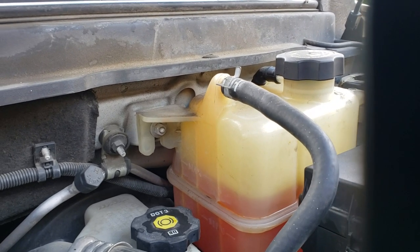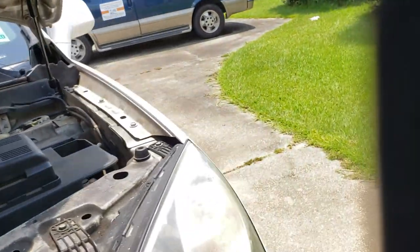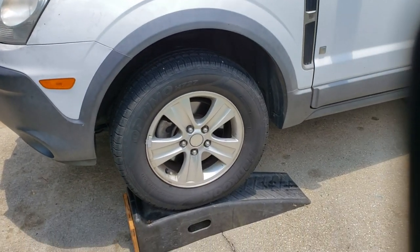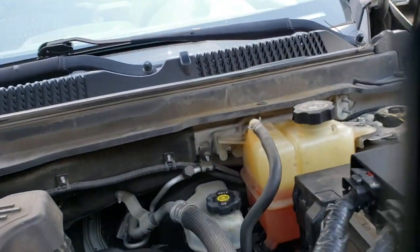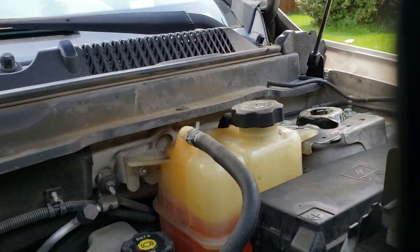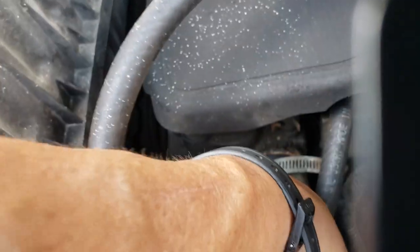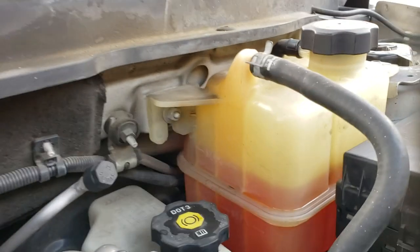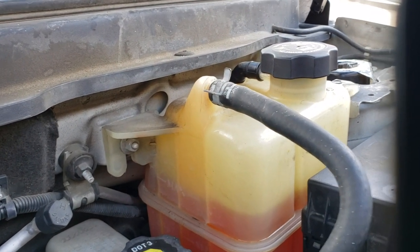If you feel you have air in your vehicle, I'll show again. Just raise the front wheel using the ramp, make this reservoir the high point on your engine, and squeeze the upper hose like me. Every time I squeeze, you burp the air out of the system, like what you see right now.